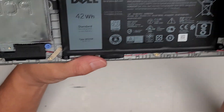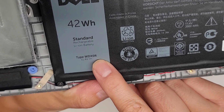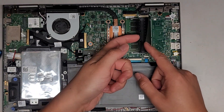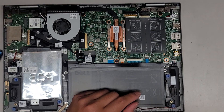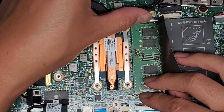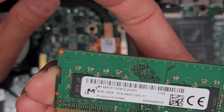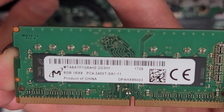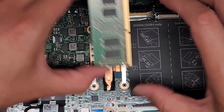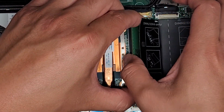You've got the battery — I'm not going to be removing it, but the battery model number is WD-X0R, a very common Dell laptop battery. You've got two slots for RAM; it looks like only one is being used. You can pull the two tabs away from the stick of RAM, it pops up and you can pull it out. The RAM is PC4 2400T — an 8GB stick. You can add another 8GB stick, or get two 16GB sticks and upgrade that way.